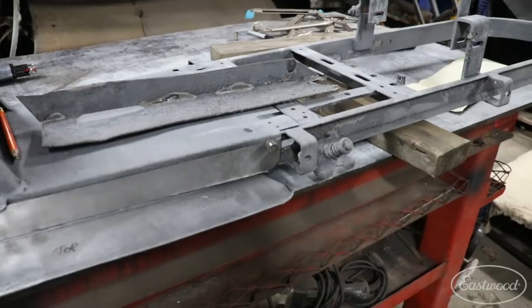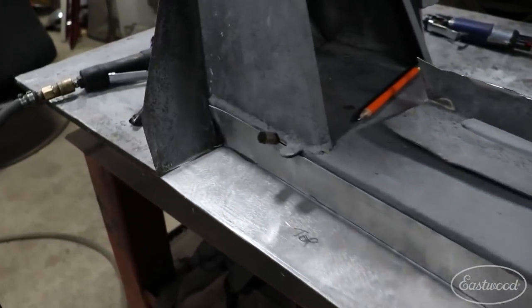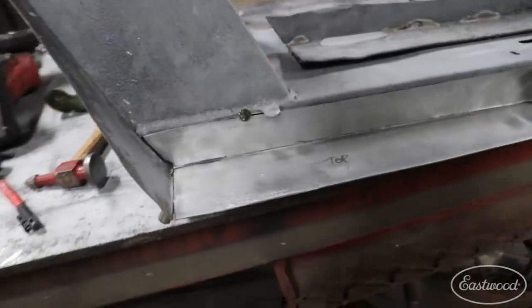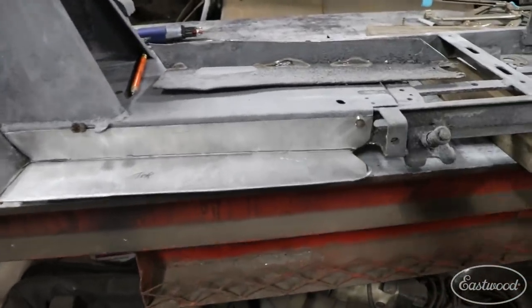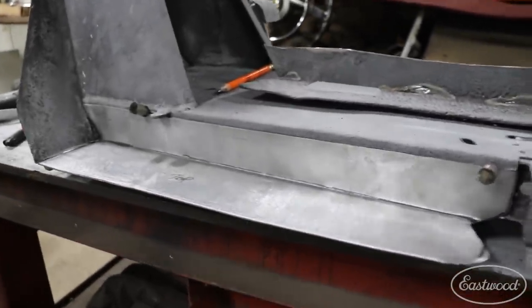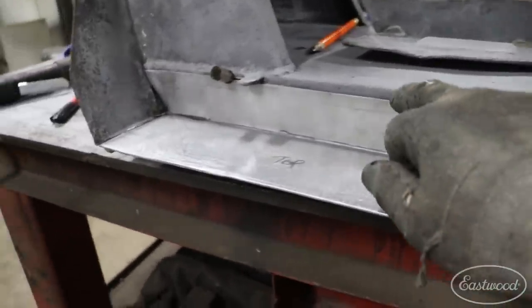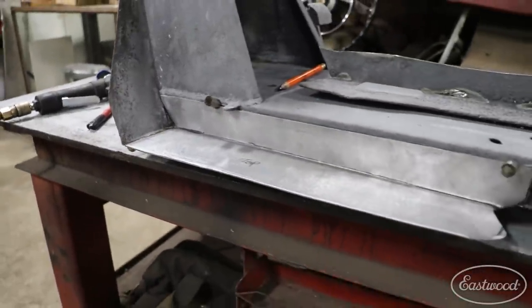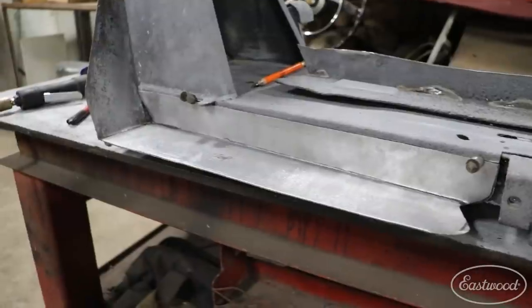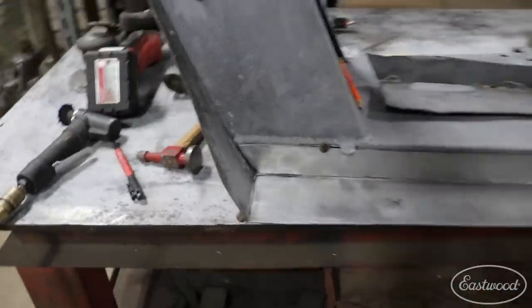After a little bit of sanding where we broke that center line and got everything to fit up, I'm just using three little stitch weld magnets to get everything set up. I got one down on the bottom and it's fitting pretty good. Now I do have it overlapping just a little bit because this is more of a straight edge on my patch panel, and it's laying over top in some spots where the cut wasn't perfectly straight. So I'm going to take a scribe and just scribe a line that matches our patch panel, trim that out, and then it'll be a nice butt weld that we can fit in there, weld it in, clean it all up, and call it good.